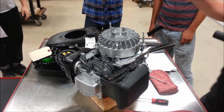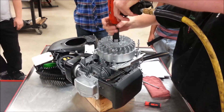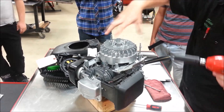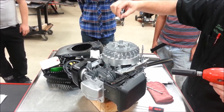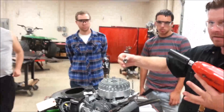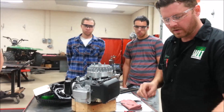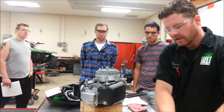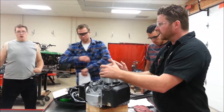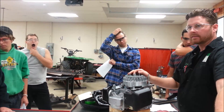Since this can rotate and I can't hurt anything, I can simply go onto a flywheel without having to hold it or support it. You see how it just got a little spin and popped off. This is a safe way to do it for disassembly. But is this the way to assemble it? No, not at all. When we assemble and torque fasteners, we want to absolutely make sure we are holding it properly and torquing it with a torque wrench, not just using an impact.